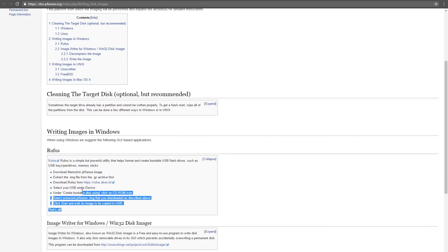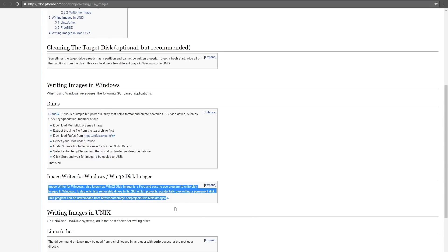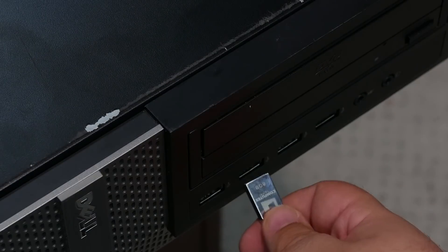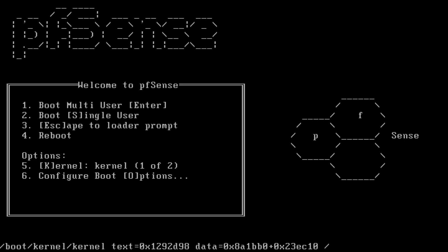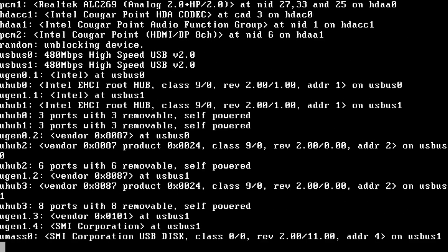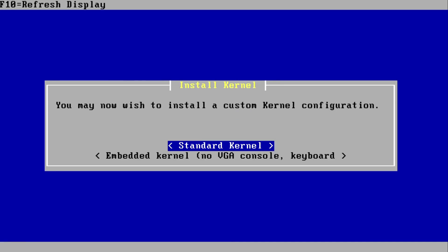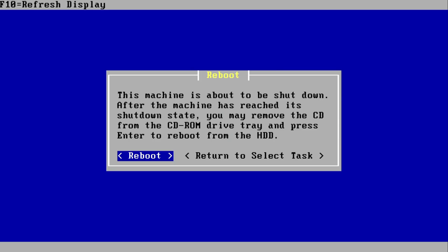Once you've created your USB stick on Windows, you use Rufus. On Mac OS or Linux, if you're creating a USB stick from there, you can just use DD to write the image directly from the disk image file to the actual USB stick. The installation instructions for how to do that are online - there's a link below in the description. Once you've got your USB stick, you plug it in the computer and boot off of it. The installer will come up and ask you to configure settings like your keyboard layout and some physical parameters. You're just going to hit enter and next all the way through. Once you do the installation, it'll copy the data from the USB stick to the onboard hard drive and then reboot.